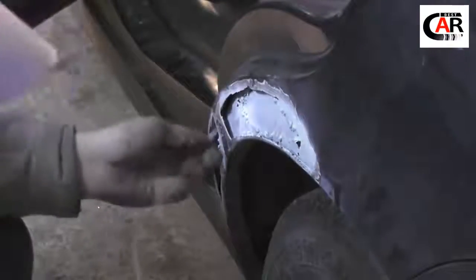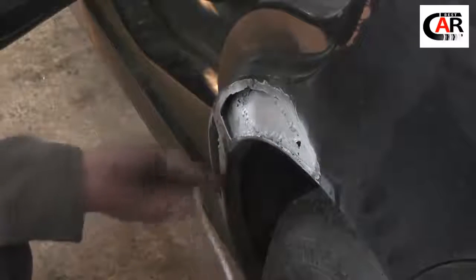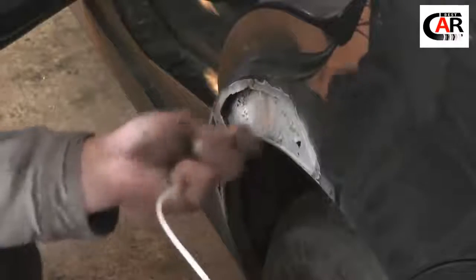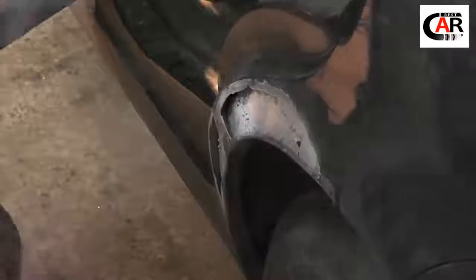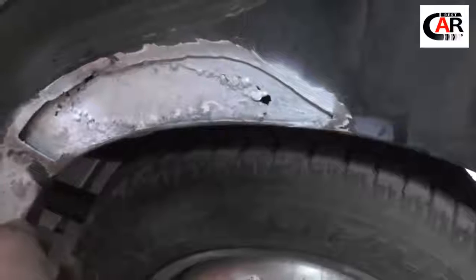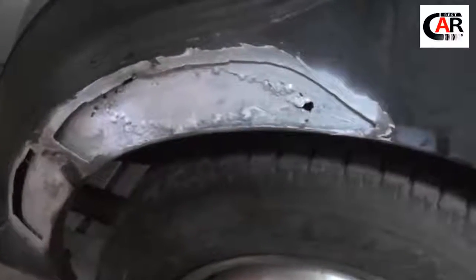Now we will treat the inside surface. The pipe allows us to treat surfaces we cannot reach with our hand. In the seals, above those, I apply it generously. I'm not afraid of flammability — the main thing is it can reach anywhere. It could potentially catch fire in the dome while welding, but we will not weld that hard. Cover all the seams. This hole will not be welded, but we can use it to apply cavity wax once again. After welding, the metal will get red hot and cause some issues, so we will wax it from the back as well.